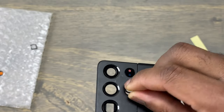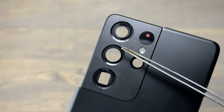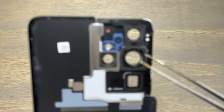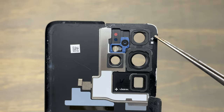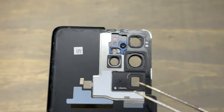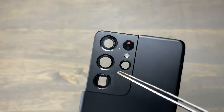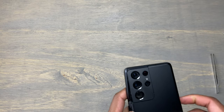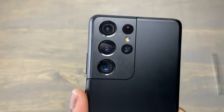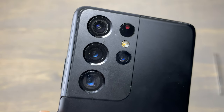Right now we have replaced all the lenses but the job is not done yet. Samsung made a big move by going plastic and aluminium on the back of this device. About 80% of the back cover is made out of plastic and the camera bump is made out of aluminium. The benefit of using aluminium and plastic is that they cannot be broken easily — if it was a glass back cover, you would go to the repair shop very often, like we did on the S20 and the S20 Plus. However, the way they implemented the camera bump and the other side of the back cover is not very good for water resistance.